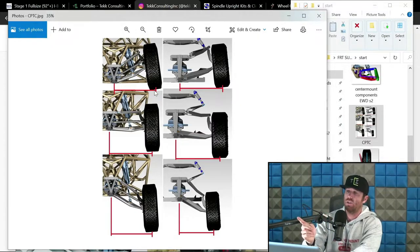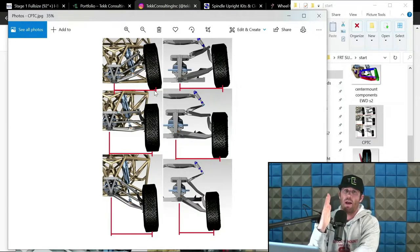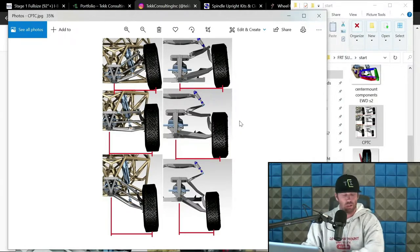In the case that you're seeing on screen, that full extension actually comes back to negative 3. That's called CPTC mitigation at extension. Again, there's a lot of debate in that, and I'll go into more detail on that in a second. But my point being, even though your ride height is a degree or a degree and a half, you don't want to let it go positive at extension. Going positive at extension is not a good thing for multiple reasons, especially CPTC.